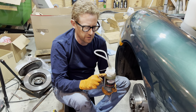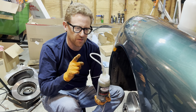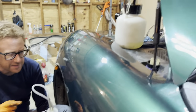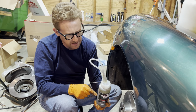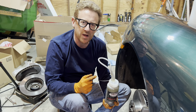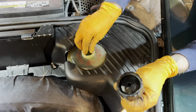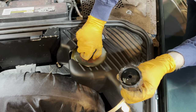All in all, we got two full catch cans out of this car before it went clear again. Pro tip: pumping the brake pedal really forces fluid out of the nipple and down to the catch can. Keep the pressure high on your power bleeder but also pump those brakes, because then it really starts to come through and you can see the difference between the old horrible dark brown stuff and the clearer yellow fresh fluid. We'll put the wheel back on and then test the car.